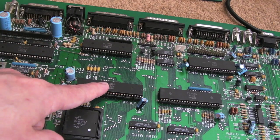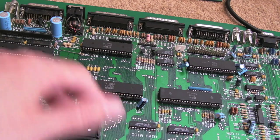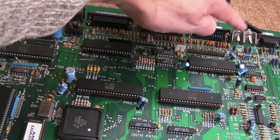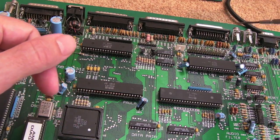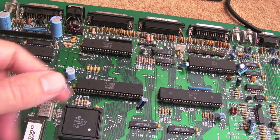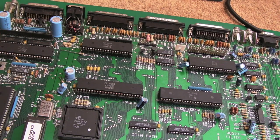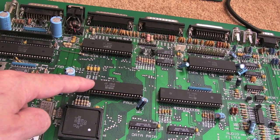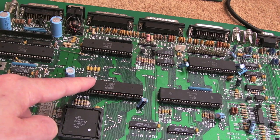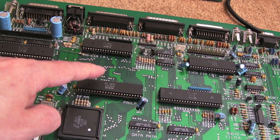Paula provides the audio - PCM audio, 8-bit, four channels, two to the left and two to the right. Some people do a mod to mix the audio channels - I think Miss Madam covered that in one of her videos - to blend maybe 25% of the left channel into the right and vice versa, because otherwise you get a very distinct hard separation since two channels are physically on the left and two on the right. You can get up to something like 29 kHz sample rate, so that's pretty good for the time even if it is only 8-bit. Your serial connections go through Paula - I only discovered that from looking at the schematics.